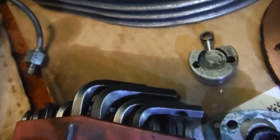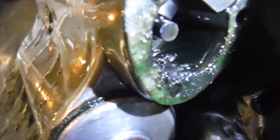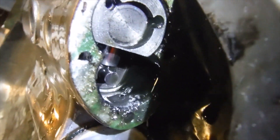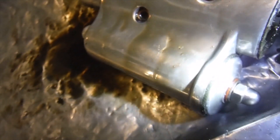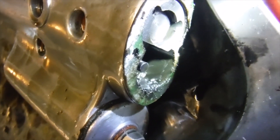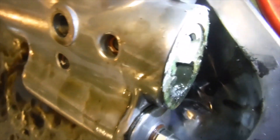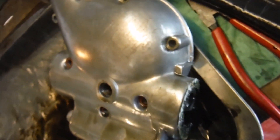The feed pump is in good condition, though there was a little bit of dirt in there, which is quite surprising. There's a lot of metallic residue being pulled through and dumped there. I'll check the scavenge pump assembly is in good condition and fit for further use. I'll also be chucking the old filter away and fitting a new oil filter. Once I prime the new oil filter with fresh oil and I'm happy the oil pumps are okay, the timing cover can go back on. I'll also blow all the oil ways in the timing cover through with an airline, just to make sure there's nothing lurking in there.